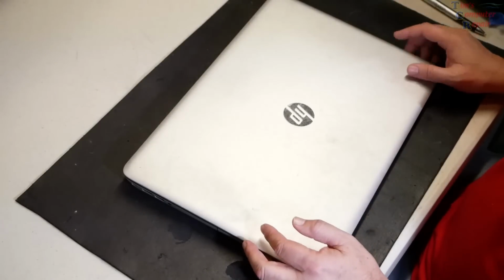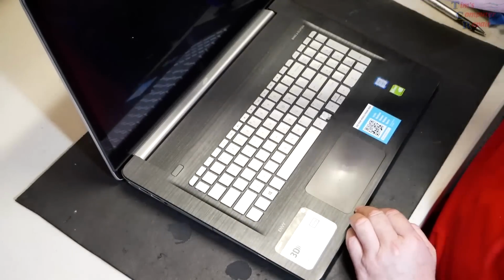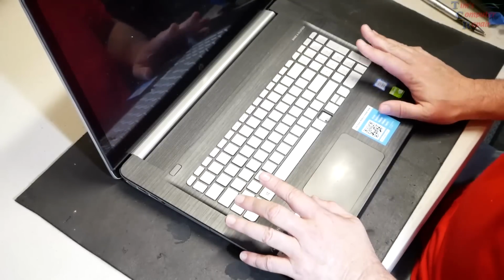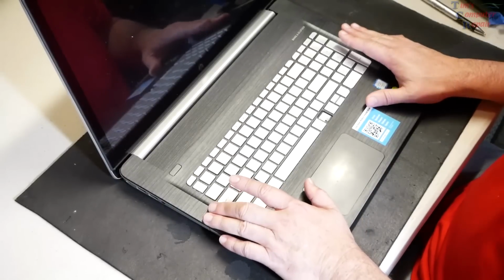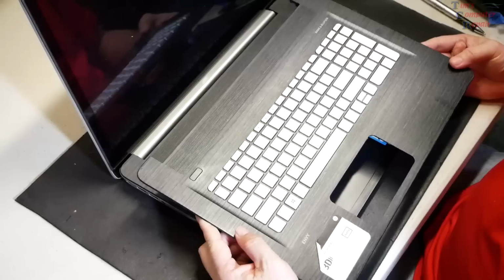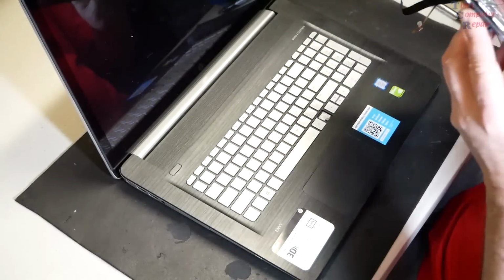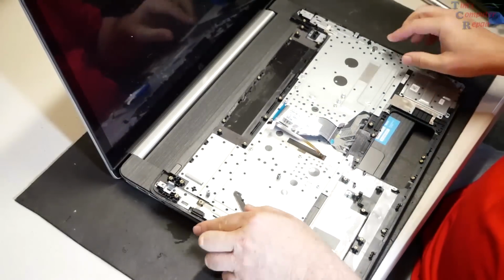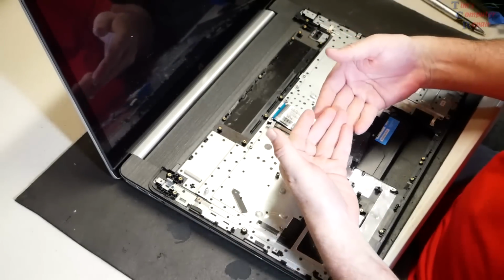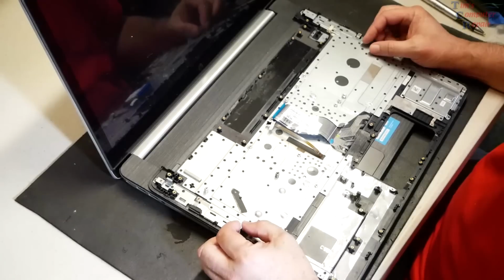And there's different revisions and such, and some, we'll go ahead and open this, some have keyboards that can easily be removed from here. A lot of them have keyboards that are built into the palm rest, such as this, and this is the replacement. And there are some videos that actually show you removing this metal plate and then swapping a plastic white insert, which is your backlight, and then replacing the keyboard.